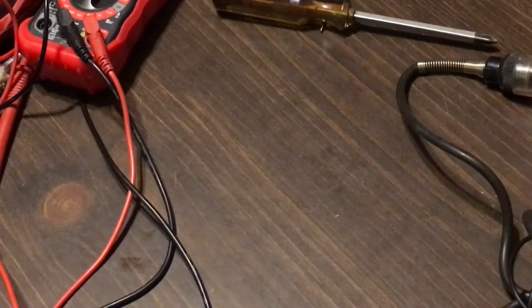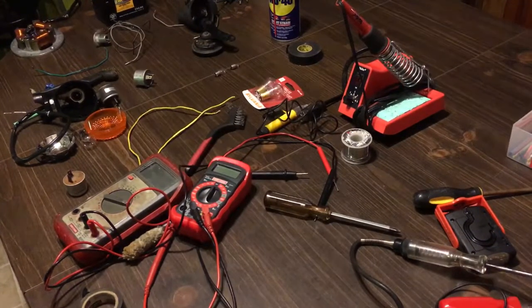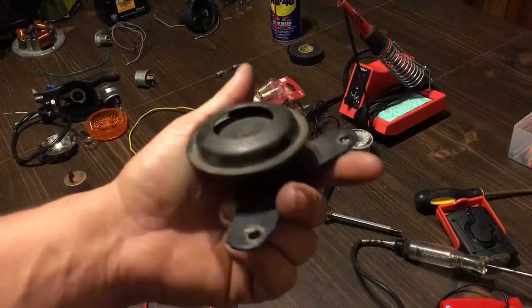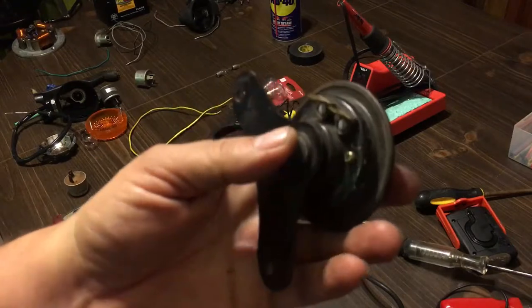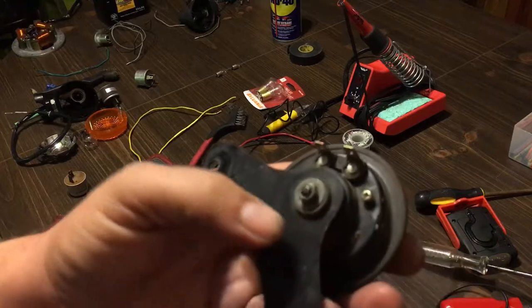That's the battery I use for that conversion. Moving right along — the next common question is my horn is not loud. I've got a typical horn here, a regular standard KE100, same as the KM100, and all the 6 volt versions. You get your positive and negative — it doesn't really tell you on here so you kind of have to swap the wires around. It's a 12 volt negative ground system anyway.